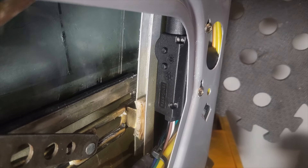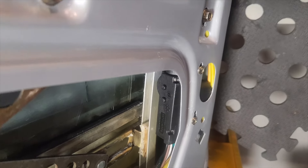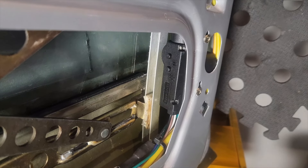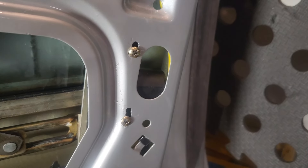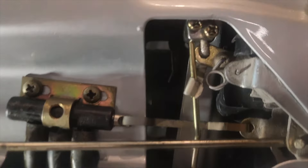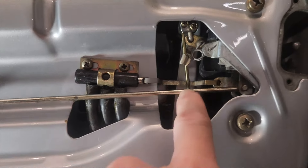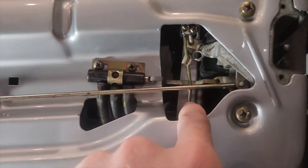The actuator has been secured to the door with two screws at the bottom - it's got everything you need in there. The door previously had one fitted, hence the holes, though this newer unit was a slightly different length so I slid it down to fit. It comes with an attachment rod which extends up to your door lock release coming out of the trim. The rod goes up and is screwed onto the door control - you can see the two Phillips screws and the little circlip connecting it. This then actuates the horizontal bar for the vacuum, doing the rest of the doors.